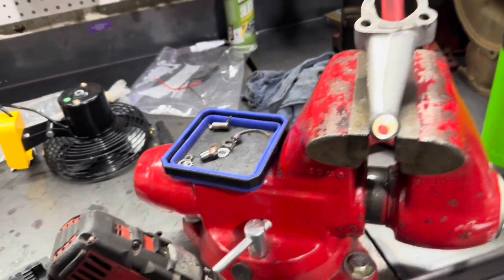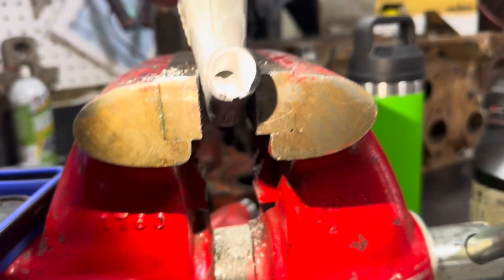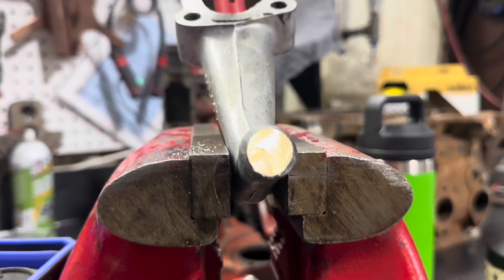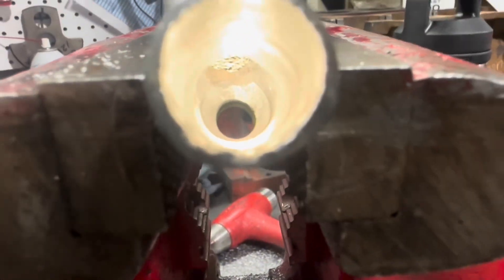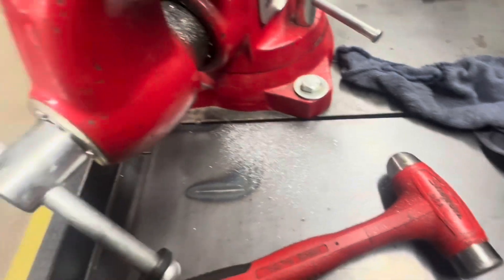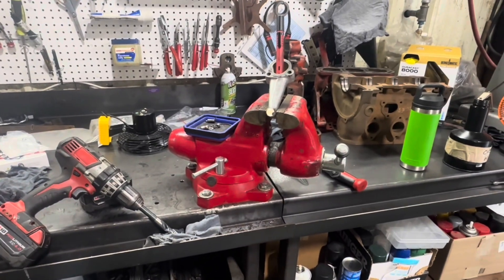The bend is good, so I'm going to try that. I got in there and opened that up and I think it really helped. I took a lot of metal off. I'd be careful as it's hitting up here on the inside — it's pretty thin there — don't blow through it. But it's actually pretty good now, because it was not opened up. Obviously the drill bit opened up this part, but this tunnel through here — I got metal all over my bench. I would do that if you're modifying that bullnose water outlet.